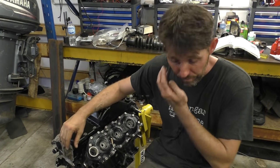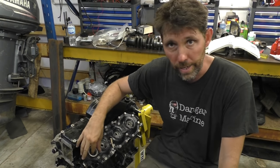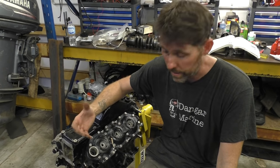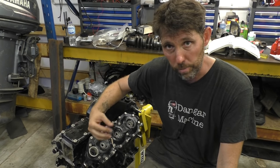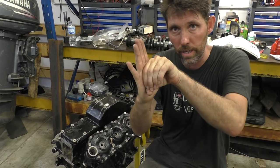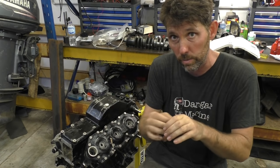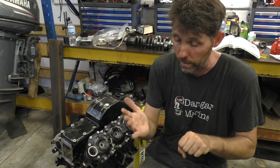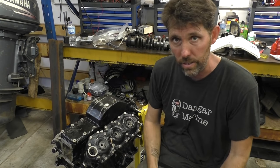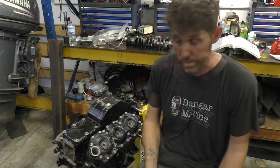All right, well, that's the port side done. Probably could have been a little bit neater with the silicone, you know, you got me there, but it'll do the job. It's really just about sealing off those water galleries. It doesn't even matter if you've got too much and they block up. All those blocks we pulled out, all that happens is a gallery comes along and comes flush against the head of the motor here. Water doesn't flow through it, so it doesn't matter if a bit seeps in, like those plugs we pulled out. All it's stopping it doing is coming to the end and then running along and coming out the head, so it'll be fine. Then you've got the O-rings actually sealing the compression gases.